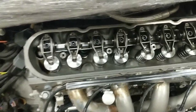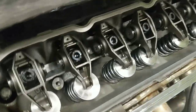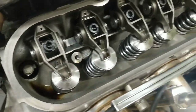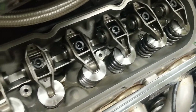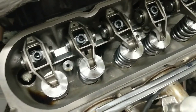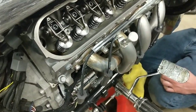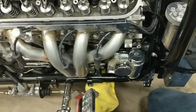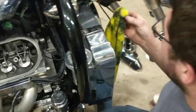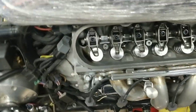Now we've got all the rockers installed. There's a good look of an LS3 head with the staggered rocker arms, as well as the Texas Speed polished dual valve spring kit and the titanium retainers, the trunnion upgrade, and the new 6mm hardware. The plugs were all checked for gap, the wires are going back on, the valve covers are going on, and we're not too far away from starting this thing.